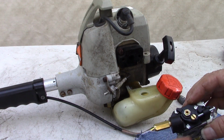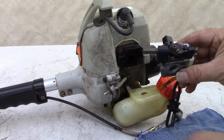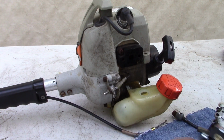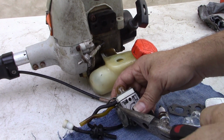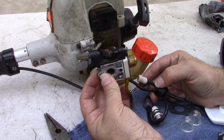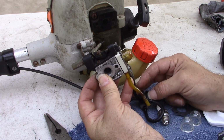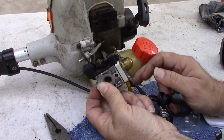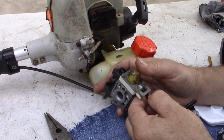The new carburetor has the mechanism on top that will let us just pass this right through using the same mechanism. Alright, so also we're going to take off the fuel lines, and I'm just trying to, from my own memory, want to remember. So the line that is the return line is the one that, when mounted, is closest to us. Alright, so let's keep that in mind. The return line is the one closest to us.